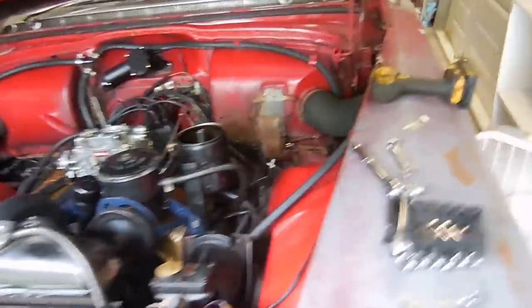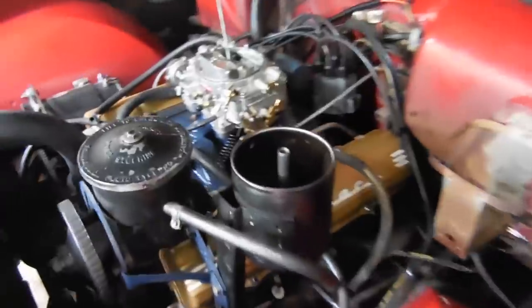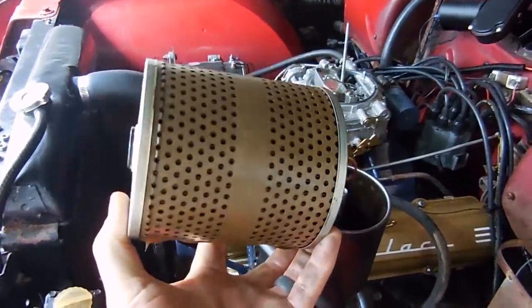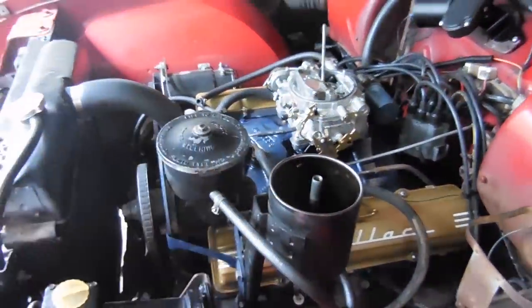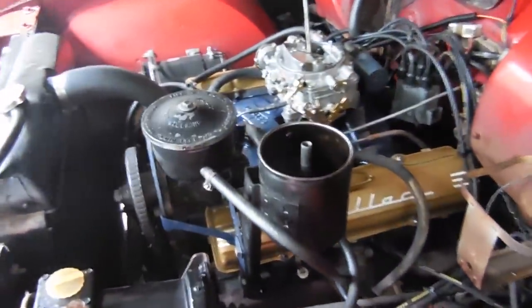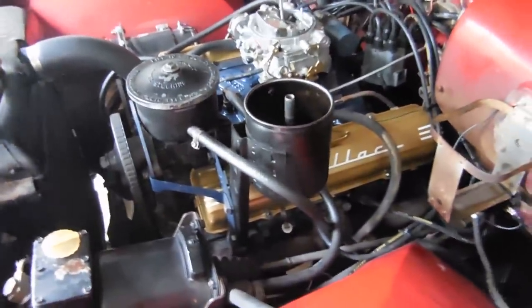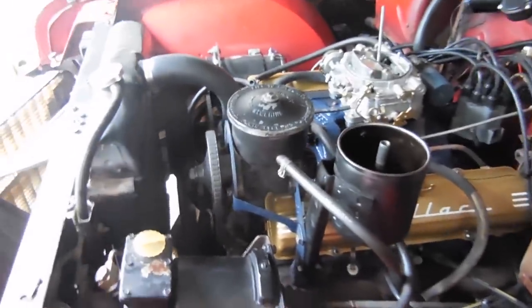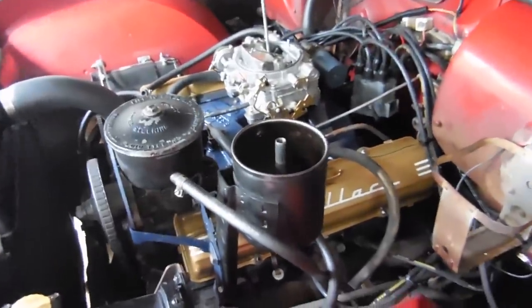I wanna show you guys this. Some of you might not have ever seen anything like this, but here's the oil filter at the top of the engine. Here is the old filter. That's what the oil filters look like on these cars. I have a new one to put in, but I believe the capacity for these is 5 quarts in the block and then 1 in the filter. We'll have to see. It actually doesn't say in the service manual how many quarts,